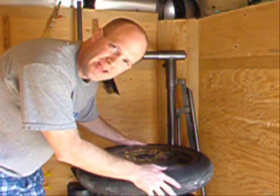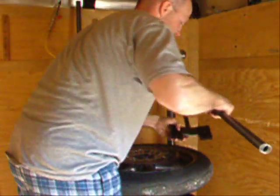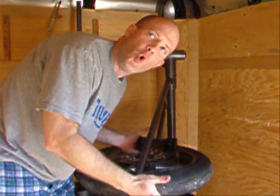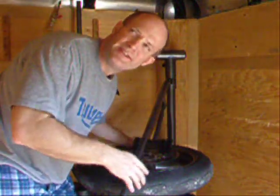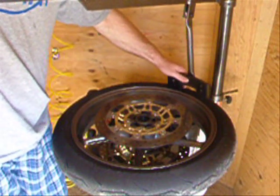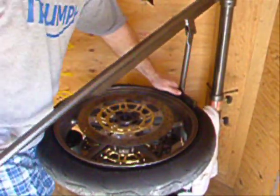First thing we want to do, get the tire situated nice and easy on top of the camber blocks here — it's just sitting on top of them. We've got to break the bead on the tire first. So the first thing we want to do is get the bead breaker out. Of course I let the air out of the tire. Now, let's get you guys a little closer up so you can see. So now we've got the tire on the camber blocks. Let's break the bead on this puppy. Basically, you just put the bead breaker up against the rim and the tire, give it a good push, and the bead is broken. Do that all the way around the tire on both sides.